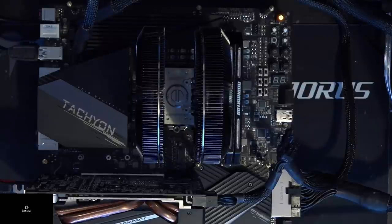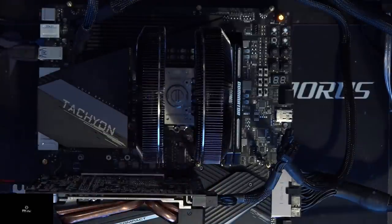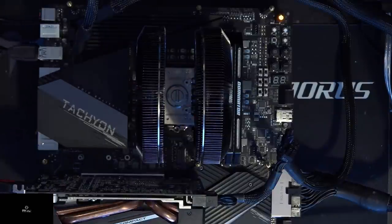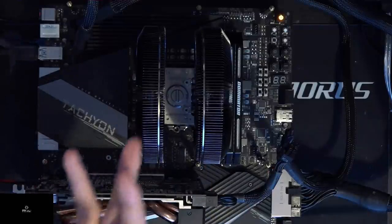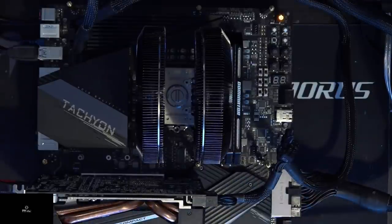The great thing is I can literally put it on like this, let gravity take care of the mounting pressure on the CPU — which is not great — and it could probably cool a little bit more if I actually had mounting hardware. The thing is, most AIOs, you can't do this because the tubing puts so much strain on the block — it'll always just pull it up. With an AIO there's not really any practical way of achieving something like this, and AIOs also take up desk space — the radiator's big.